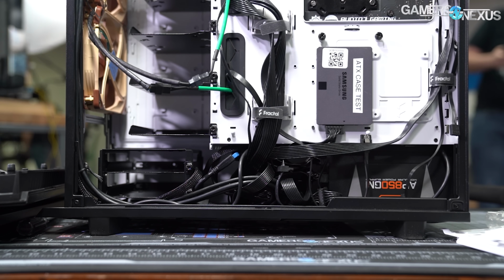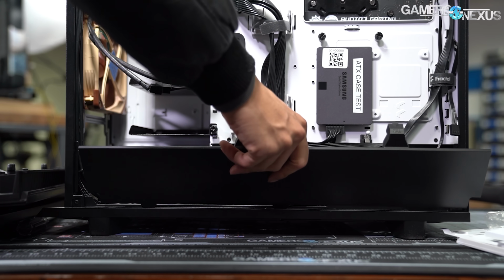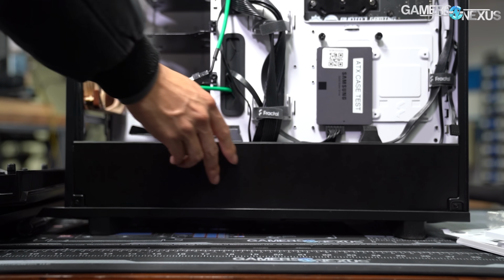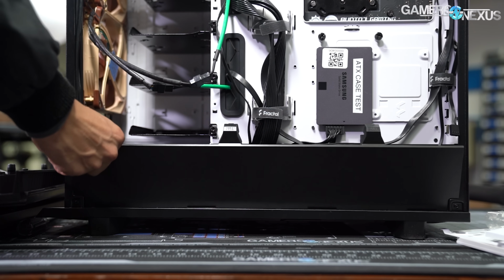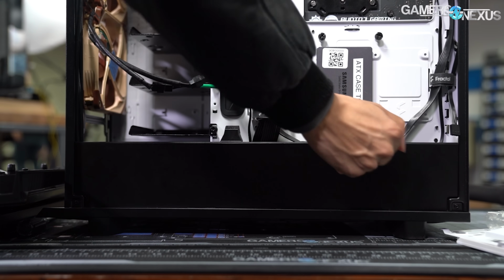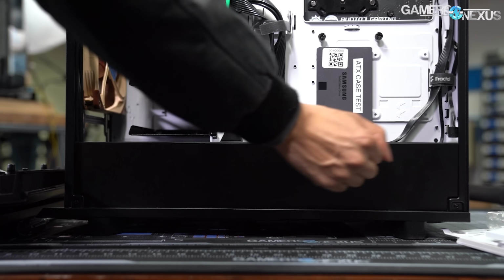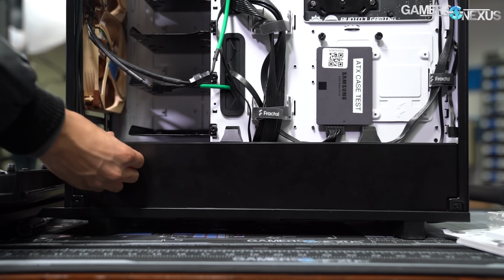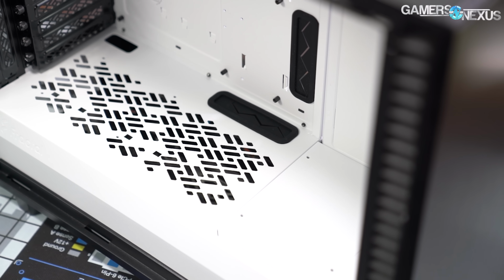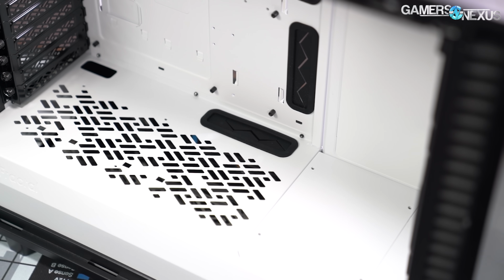The hard drive cage under the power supply shroud fits 2 drive sleds, but with so many mounting options inside the case, that's barely worth mentioning. What is worth mentioning is that Fractal has taken advantage of the extremely long case form factor by mounting the cage on rails that allow it to be placed anywhere from right against the power supply to mostly flush with the front panel. Even better, the rails can be used to mount hard drives or fans directly to the bottom of the chassis. Putting fans under the power supply shroud like this has extremely limited usefulness.